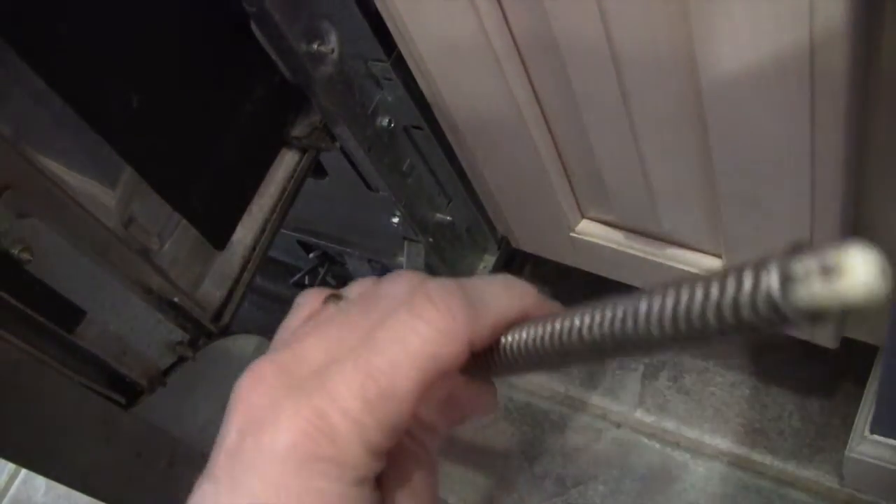So we're back at the dishwasher now. You can see that this just kind of goes in here. And you can see here that the spring is barely long enough to keep this thing in place. If it were longer, it would have upward force on this white bracket, which would hold it into place because there is no other retention for it. So this is the used spring — as you can see, it just barely holds it in place and it will fall out.